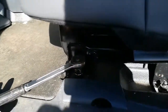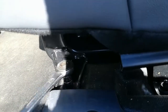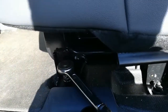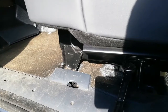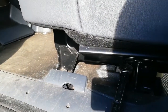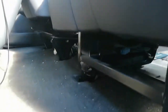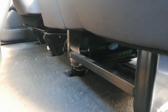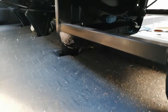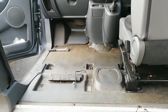In any case, because this seat has absolutely no adjustment on it - it is literally just a bench seat - there would be no option; it has to come out via these bolts that go through the floor. I've already loosened one; they're quite stiff to start with, as you'd hope because you don't really want that seat coming loose. Having started on the door side and it going a lot more easily than expected, I'm now thinking the two bolts on the other side of the seat actually bolt in as if it was a single seat. The bolting points are the size of a single seat but the seat then overhangs to be a double. Those over there are going to be a little bit trickier purely because I'm going to have to contort myself to get under there.